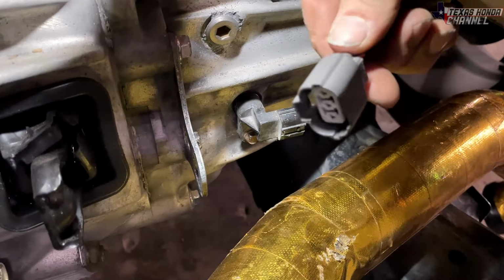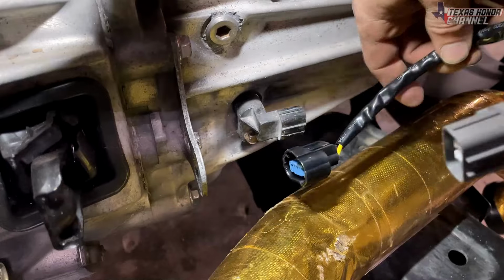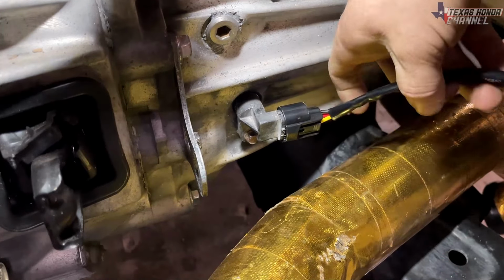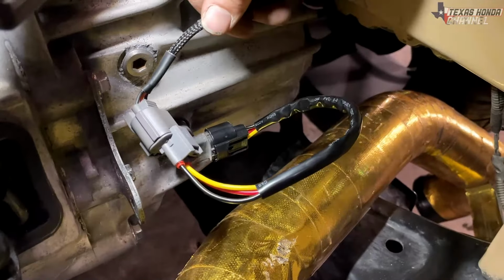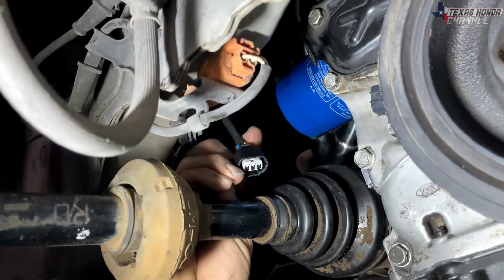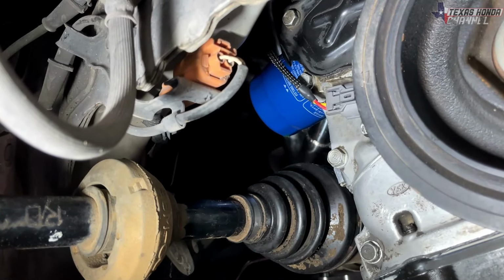Moving over to the transmission, we have an 08 speed sensor, and that is not compatible with the K20 wiring harness that is on this K24. So we had to get an adapter harness to go from the K20 harness to the K24-08 style sensor. Plugs right in, and that will also be linked in the description. Now moving over to the K24 crank sensor, we have an adapter harness we placed there as well to go from the K20 harness to the K24 crank sensor.